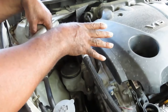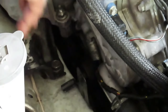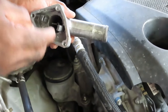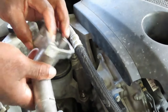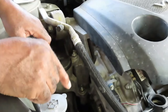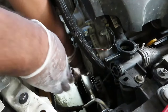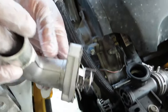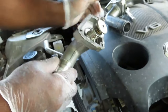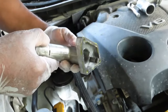We're looking at a 2014 Nissan Maxima. The thermostat is down here. I'm not going to show you how to take it apart because that's not important. We have another housing here, and I took the thermostat out of it. I'm going to take that housing off and bolt this one on without anything in it so it's free flowing. But before you do that, make sure you drain out the coolant because you're going to have a spill. So drain out the coolant, and let's get that housing in there — that's how your thermostat is going to look.